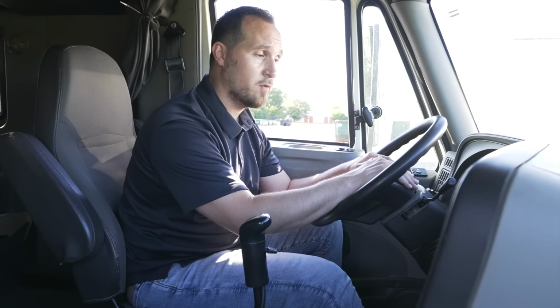Okay, my minute is up. I did not lose more than 4 PSI of air during that minute for my initial test on my air brake check. Second test we're gonna do, test number two, is gonna be A for alarms on the lab test.